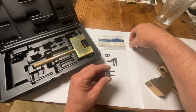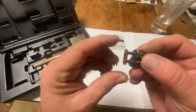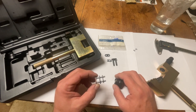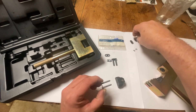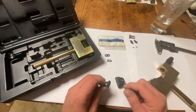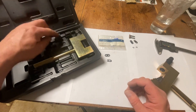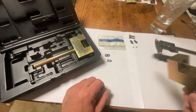We're going to use this here and press this in, even though this is like fitting a square peg through a round hole, sort of. We will make a video of this when we pull the chain in, and then we will see how this is going to work. Now, Bosch makes a set like this. I have not been able to find the actual Bosch set which looks like this here, because that's where they more or less copied it or got the idea from. It seems like it starts with the 1998 model year for these tools — whether the three millimeter or the four millimeter.